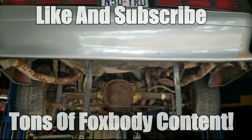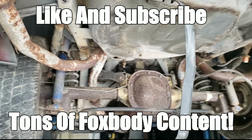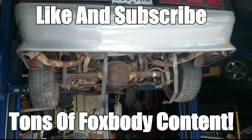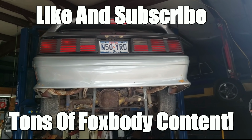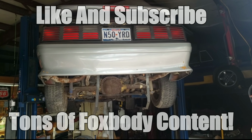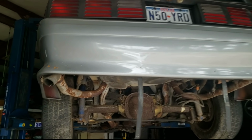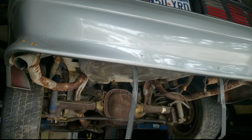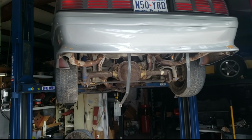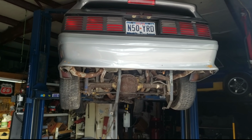So now I'm going to blow out the lines, and I'm going to put this car back outside until we can figure out what we're going to do. Everything else has been done. The heater core has been replaced. The wiring is finished for the dashboard. I am not going to put the dash shell back into the car until I can actually fire it off, so that way I can double check any circuits that may not be firing, even though I have checked them. This is the best situation where I can just leave it bare and then get it running perfectly and then finish the assembly on it. But all the hard work on this is essentially finished. I'm gonna blow out those lines, and hopefully with a new tank and sending unit and whatnot, this thing will fire back off.